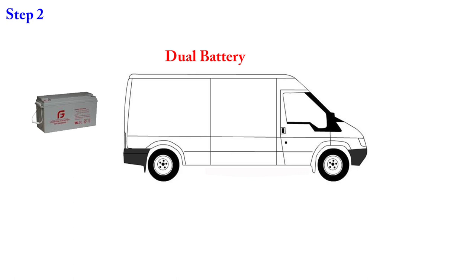You don't want a battery that will create fumes in the back of your van. If you're creating hydrogen from battery charging, that's not the type of gas you want inside your vehicle. I like glass mat because they're completely sealed — you can mount them on just about any angle, they don't leak, and you don't have to worry about fumes or discharge. So step two: get yourself a good battery.